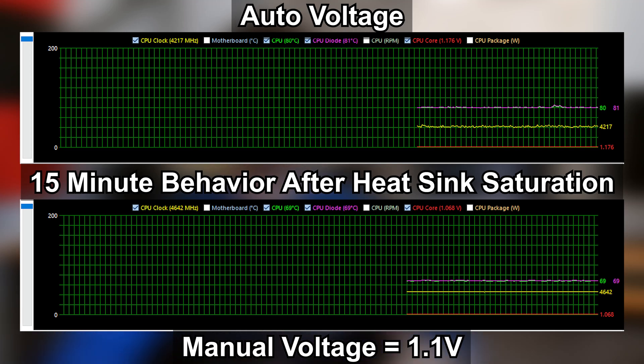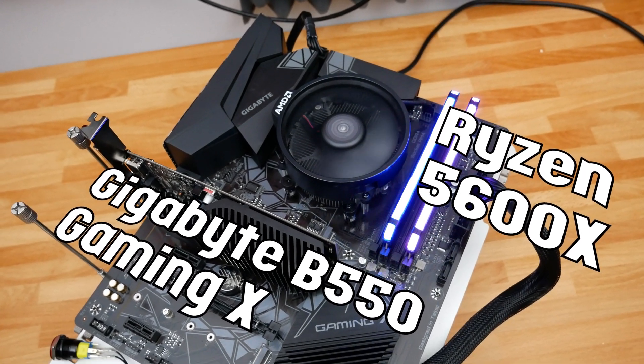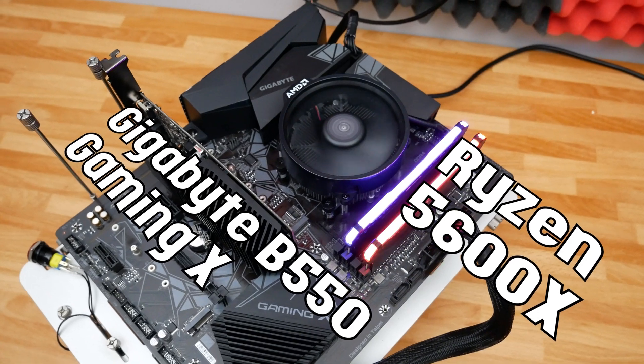That rolls us into the conclusion on whether you should undervolt your Ryzen 5600X if running the Wraith Stealth cooler. Based on my testing, I would actually say no. The simple reason is that 80 degrees Celsius is not ideal, but it's not going to kill your CPU running at auto voltages and auto clocks. You are outright getting better performance with that setup than with manual offsets or a set manual voltage. This may change depending on your motherboard, so there's definitely an asterisk — you should do a little testing yourself. But if your benchmarks are going down with offsets or manual voltages, it's really not worth messing with voltage when you're getting better performance at auto.